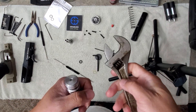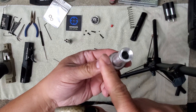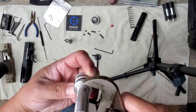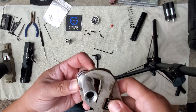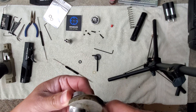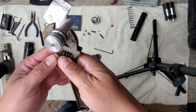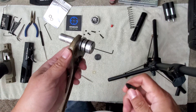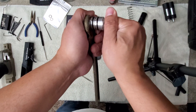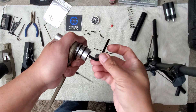What I grabbed was a trusty crescent wrench. The reason is the heat core has these two little flat ends and you don't want to really put pliers on because it'll bite into it — it's aluminum, so it's very soft. The crescent wrench will tighten down on there, hold it securely, and not damage your heat core. I'm going to remove this cap — I'll show you how this helps with replacing the heat core o-ring because it's a little tricky.